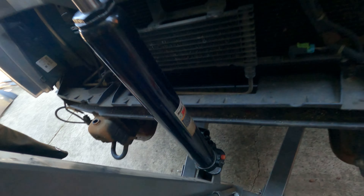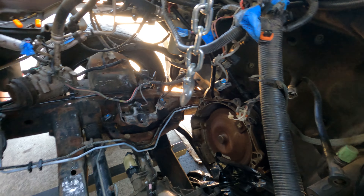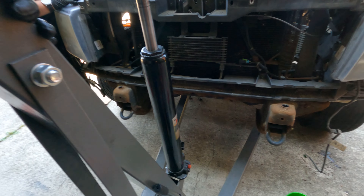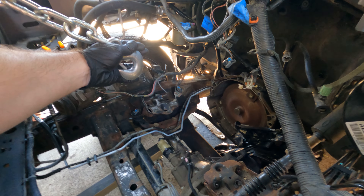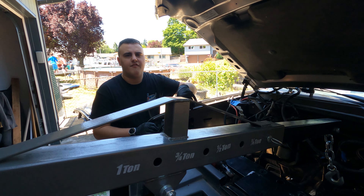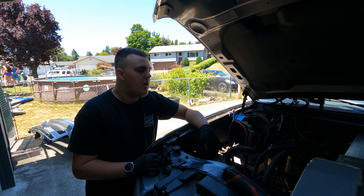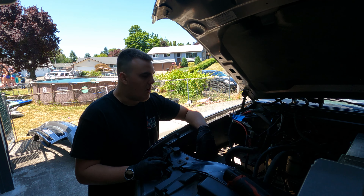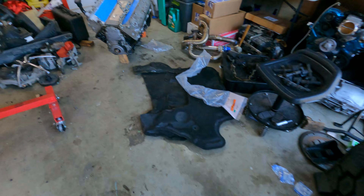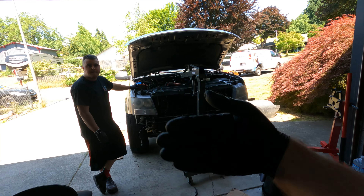The C-clip is just really annoying to get on. Tristan's going to work on getting that bumper bar off. We'll basically be able to just start putting the motor in. Let's get the harness up and out of the way and get her in there. Let's find the bell housing bolts. Hopefully we'll finally have a motor today. Moment of truth — it hits that, but that's fine, we can damage that. This comes way closer than it was before. We were probably out that far before, hitting the bumper. It was really extending the chains to pull the motor out before. We were afraid the motor was going to swing forward, but it kind of didn't because we didn't have it up enough. With the slack in the chains, it should be good. We have all this chain here, and if we need to, we can add the hook to make it longer. Actually, we do need the hook so we can swivel the motor.